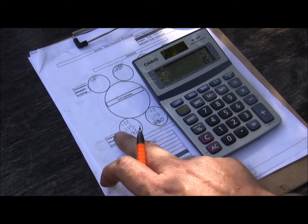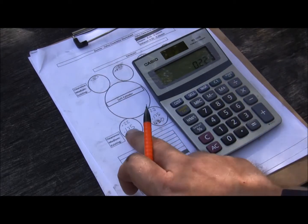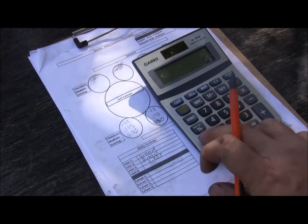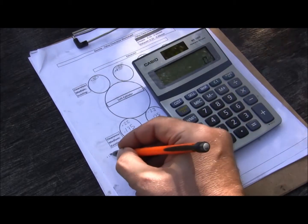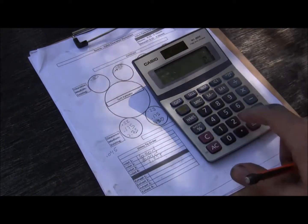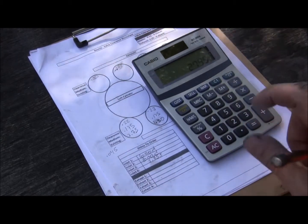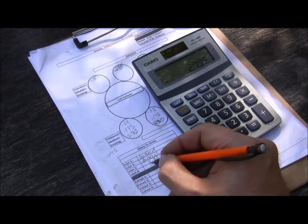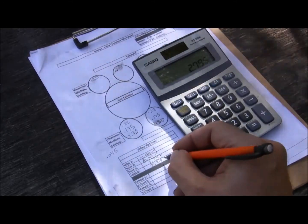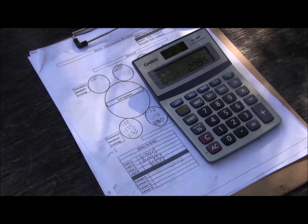Inlet 4 — figuring out the shim. Our clearance was 0.22, minus our medium 0.175, gives us 0.045. And 2.75 is the existing shim. So 2.75 plus 0.045 — we want a 2.795 shim. That's how you run your equations and get your numbers.